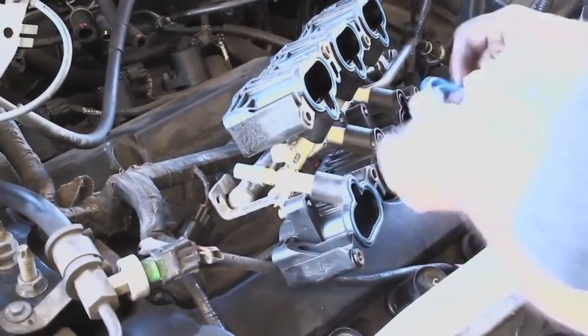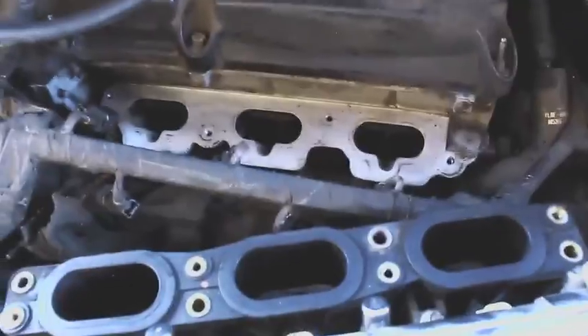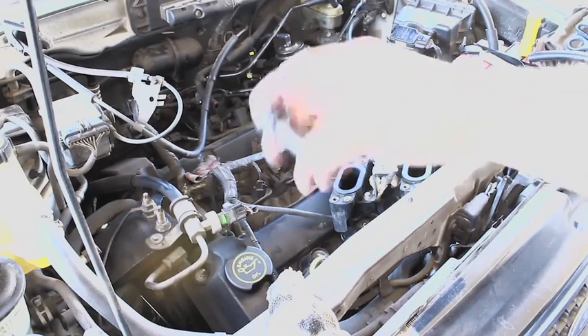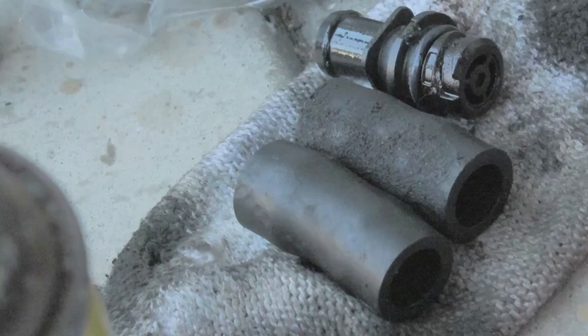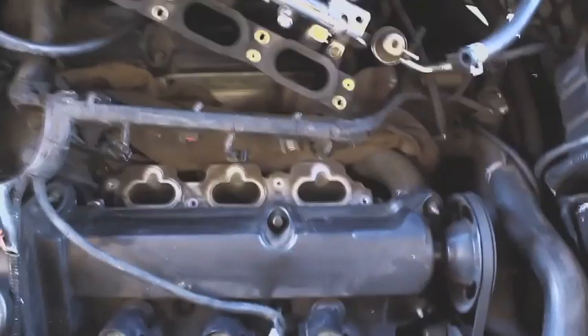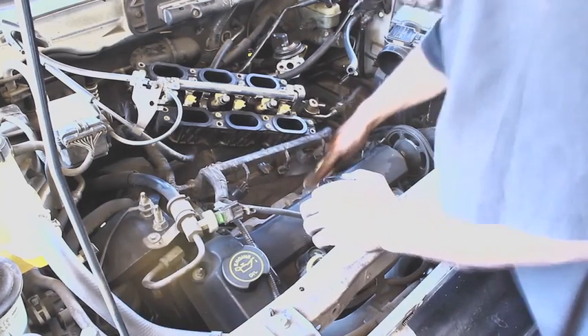I got lucky nothing fell in there. Those gaskets on the lower intake manifold are the crucial ones — obviously had not been changed probably since the vehicle was manufactured. You're looking into the actual engine block. There's the actual intake manifold with the fuel rail connected to it. We're looking at the PCV valve here. There's the new one — it's all it is, made out of plastic. Pulled out the old one — it was all fouled with oil, as you can see. The PCV hoses were hard and brittle.